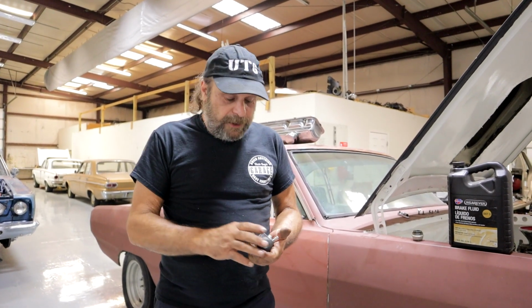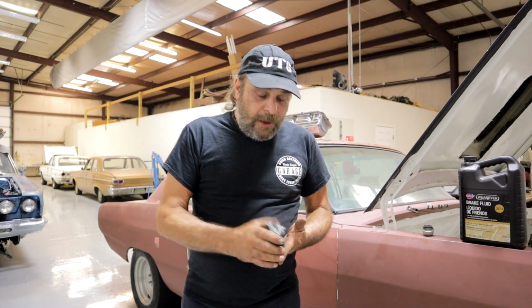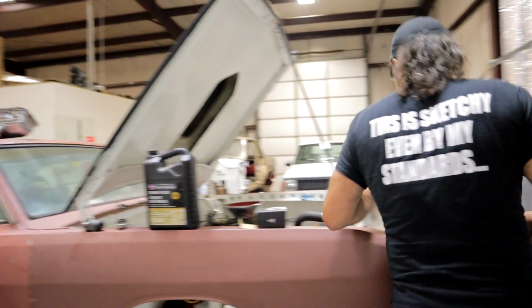A lot of people, the oil change places, dealerships always made a big deal of flushing brake fluid. And on the surface, it looks like it's one of those rip-off services. But there's nothing wrong with the brake fluid. It's not like engine oil. It doesn't pick up contaminants. No, the flushing of brake fluid every 3 years, 30,000 miles or so, prevents this from happening. It takes that water that's been in suspension for all of that time, it flushes it out, and you throw fresh in there.